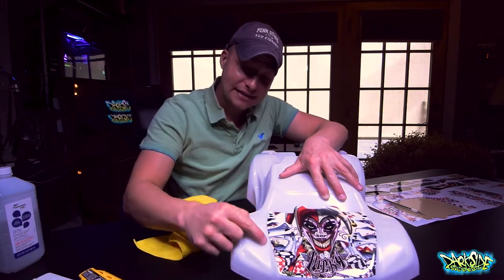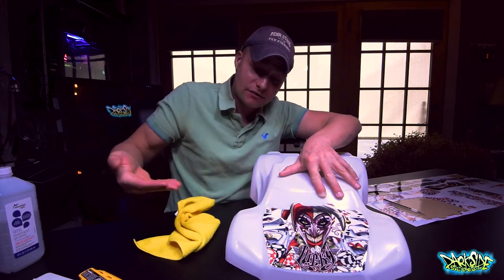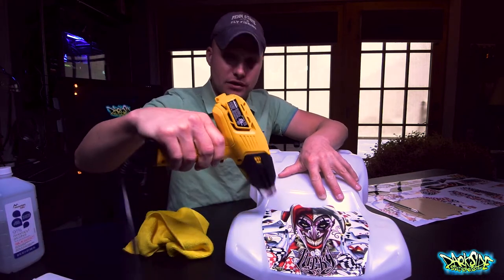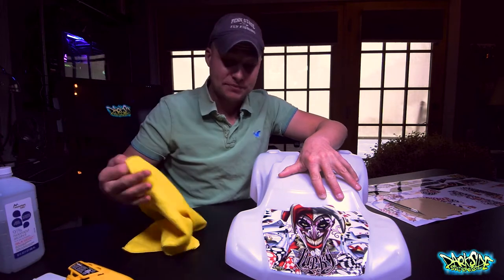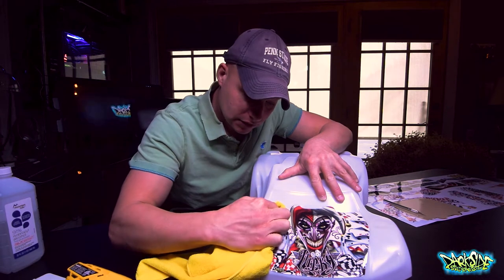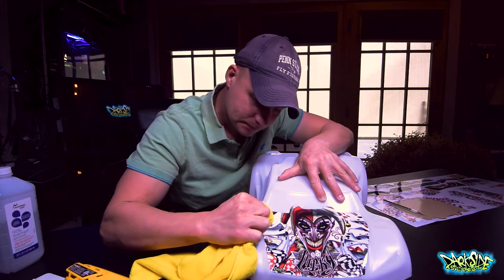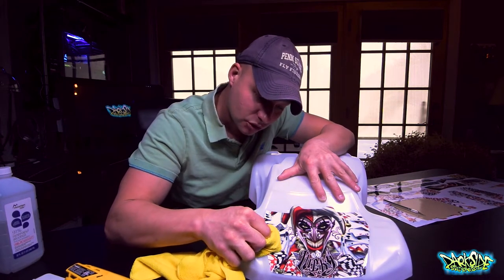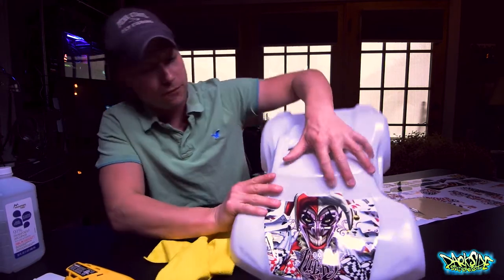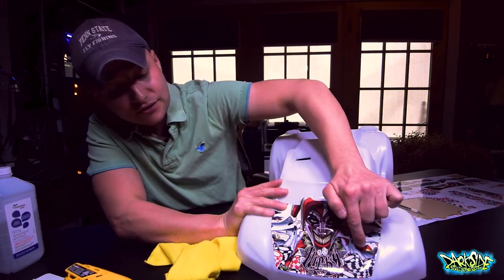This is the importance of tacking these sides first — because if I had not tacked them initially and I pushed that down, it would want to pull in on me. By doing this, we're stretching it out, sort of like rubber, or a car wrap if you've ever seen one installed. Now I'm just going to keep working my way across like this, and now I'm going to go down this channel, pushing the air out. This is where those holes that I have pre-cut into this for you are helpful. There's two there, one there, one there, and there's one in this vent depression down here and down here.